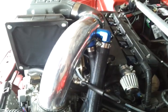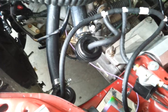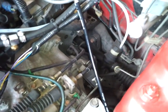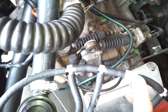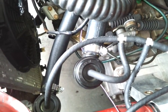I've got these two one-inch lines coming off my charge pipe here, going down to two Bosch bypass valves. Basically they're staying open on vacuum. Here's my source line right here — that's my vacuum boost source check valve. So basically they're not allowed to see boost and therefore stay open all the time.